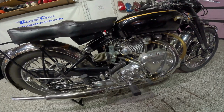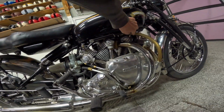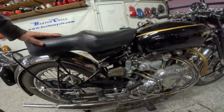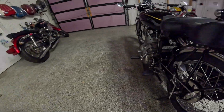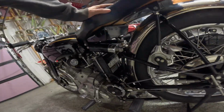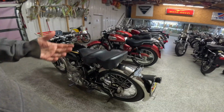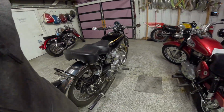Just a real piece of, hey, air pump. Check it out. This is a vent tube for the engine. That probably goes out the back. See if you can find that. Back in the old days, that was how you vented your engines. Today we run them into the air filter, and when you start the bike up, it sucks it back into the engine and burns it again.